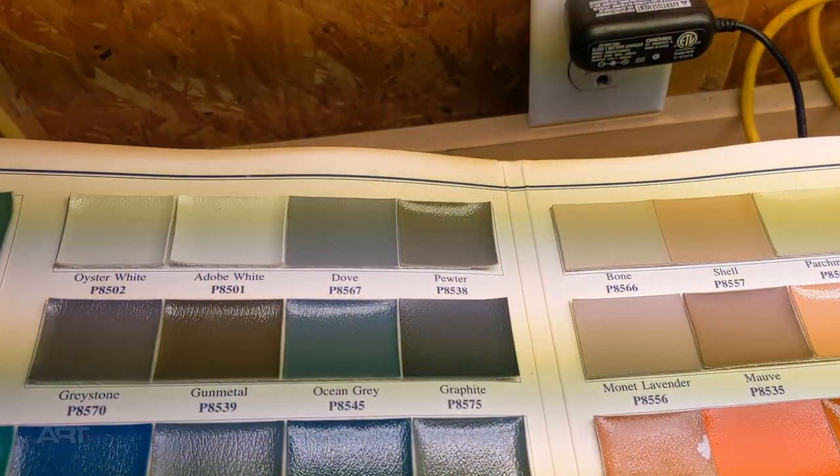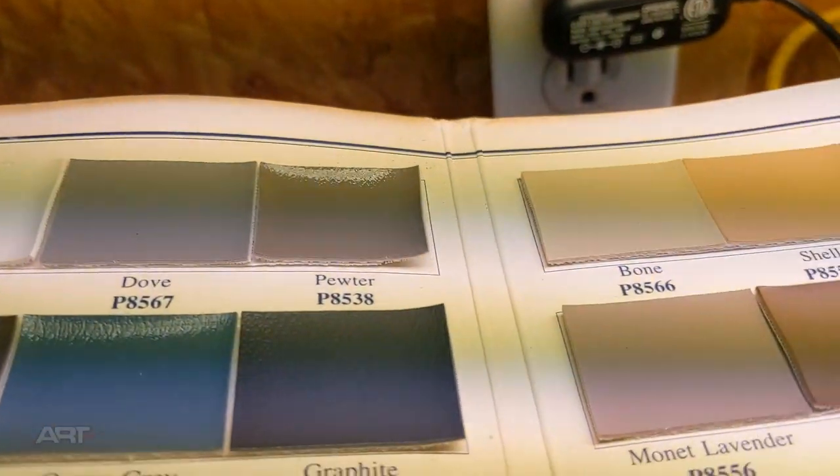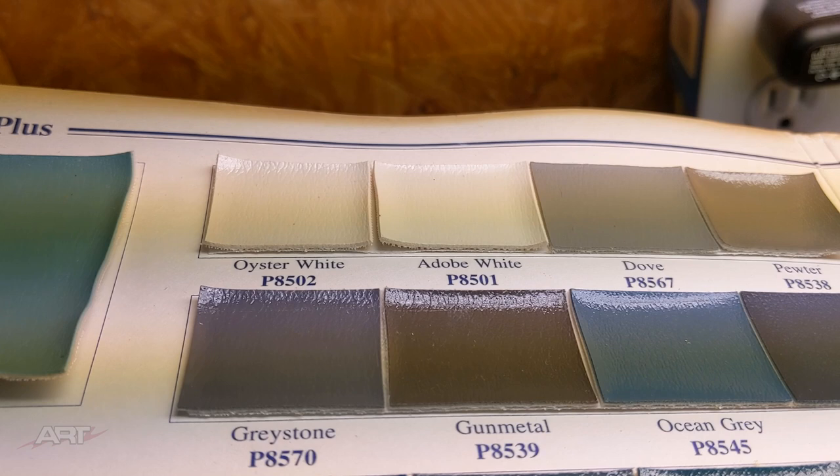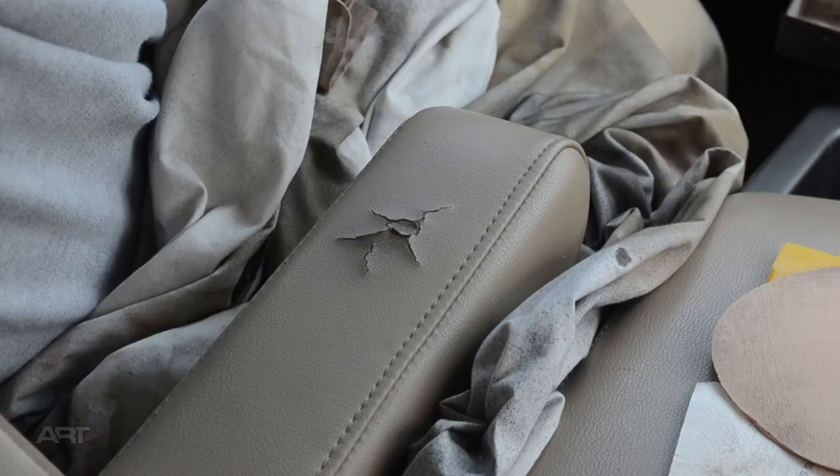You don't need to know much about vinyl to recognize the poor quality in modern cars. These samples in the book are hard as floor tiles and the curled up edges are sharp. The plasticizer has been depleted — this is what we face in many modern automobiles. This situation calls for extraordinary attention in our repair process. It will take a conscious effort to tame this brittle curled-up edge. Heating with a heat gun may not be enough to soften the vinyl sufficiently, and excessive heat can melt away the foam underneath in a split second and leave a void under the vinyl.